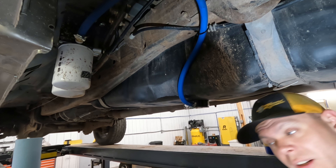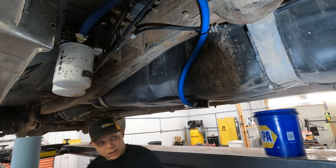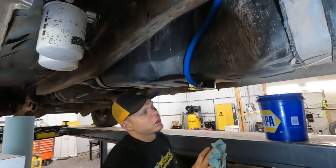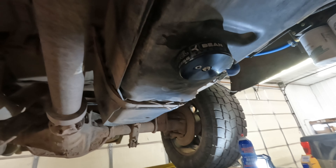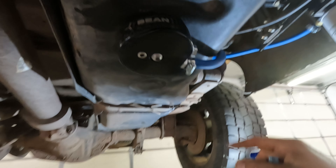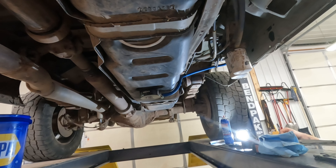Now we're going to put the truck down and fill up some fuel. Pretty straightforward — it's just a sump install after we've already installed a FAS. Just want to pay attention to where you put it in the tank. You want to try to find a flat spot and as close to the back as you feel comfortable with. Any chance of your driveshaft coming apart, one less thing to have a problem with. Now, some of these fuel tanks do come with a skid plate underneath them — in that situation, we take the skid plate down, measure, cut out around the sump on the skid plate, and put the skid plate back in. A skid plate is a good thing to have, especially when you off-road a lot.